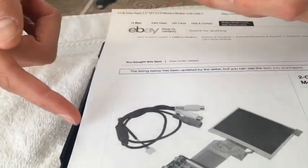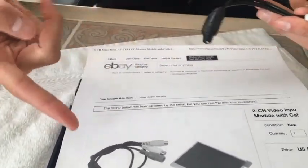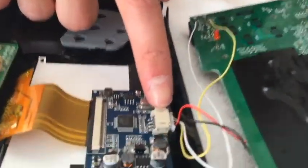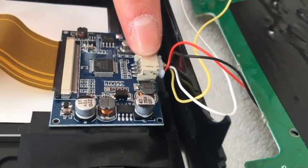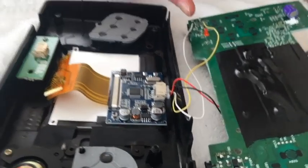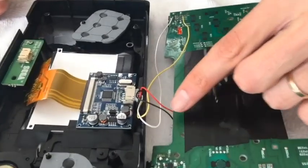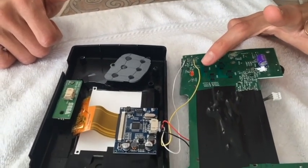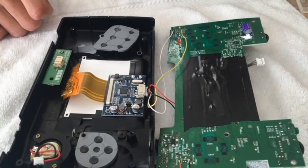Here's the connector — you can see the fat part. Below that it was just a little connector with a long wire. I cut it off at the fat part and discarded the rest. After I deconstructed the wiring harness, the end that came with it plugs into the board, and the rest had a sheath which I removed to reveal all the individual wires inside. The red one is the five-volt power, the black wire is the ground for the power, the yellow wire is composite video input, and the white wire is the ground for the video signal.